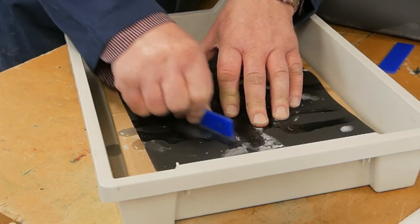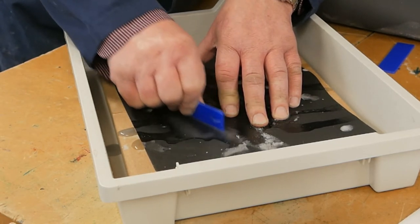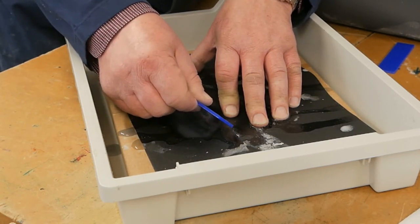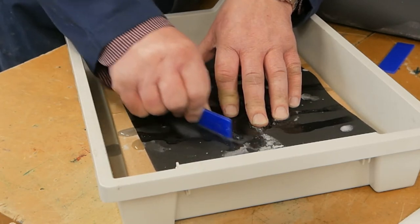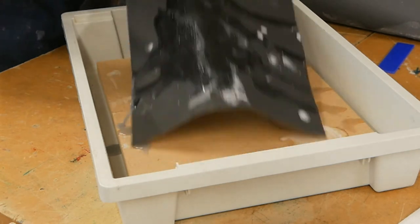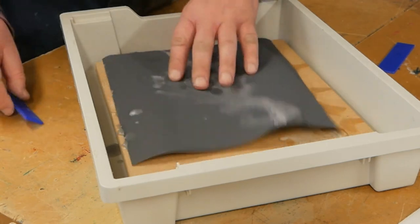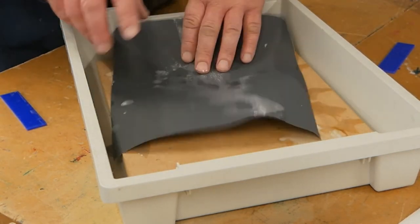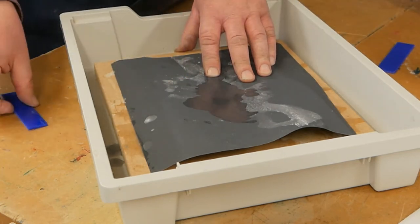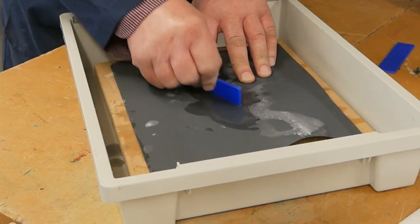Doesn't take long. Must keep it flat and upright, not tilted. Unless, of course, you want it tilted. And that way you'd work at the angle that you'd want to, but I'm doing 90 degrees today, best that I can. Okay, that's looking pretty good. Then my finer material, again my P400, a little bit of water. Just work away.